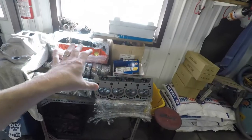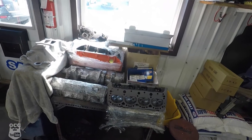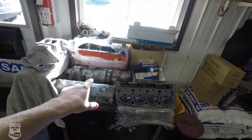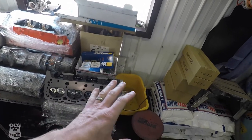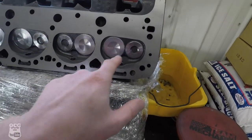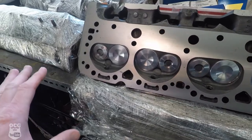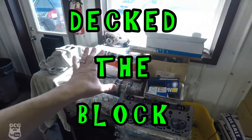Here is a table full of basically all the hard parts, or most of them, that we had sent away to St. John Engine Rebuilder — I'll put their logo on the screen and a link in the description below. We had these double hump heads sent away and they did a complete rebuild. We've got brand new valves, hardened seats on the exhaust side, and everything looks absolutely beautiful.